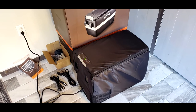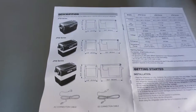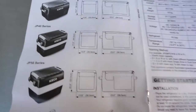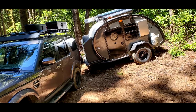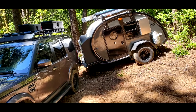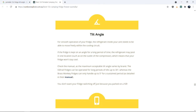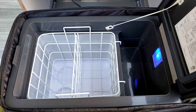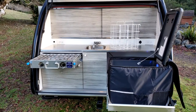The JP-40 has three stages of battery protection, which include low voltage, electrical interference, and overload protection. It also has protection to prevent damage beyond a 40-degree tilt angle. This is important when driving on uneven ground and steep terrain — some brands have no protection at all or are restricted to 10 to 30 degrees tilt.